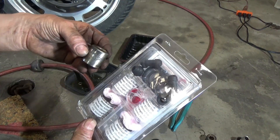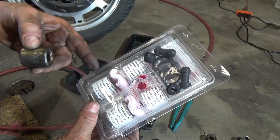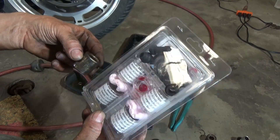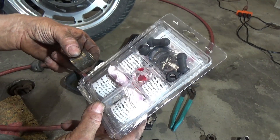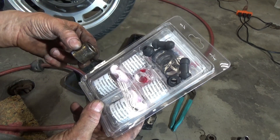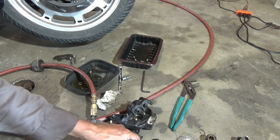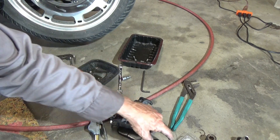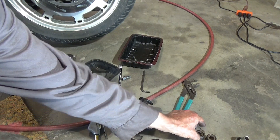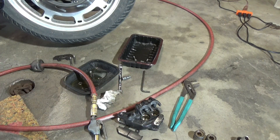When I first looked at this kit I thought this piston looks bigger than the others, and it is — but I saw that the ones on the other caliper are bigger down there. This kit is for both calipers. Apparently the right-hand caliper — the one on the hand brake side — is bigger, and the one that works with your foot brake on the other side is smaller. So you get more braking power with the bigger pistons on the hand brake side.